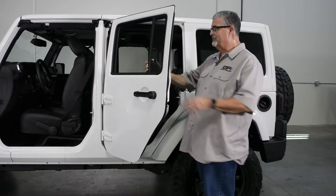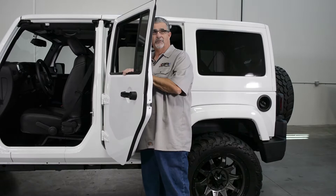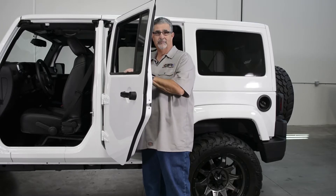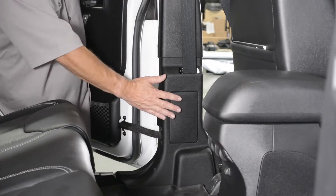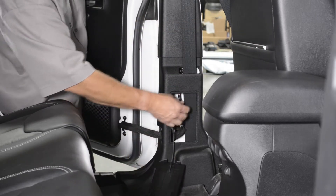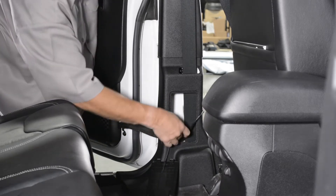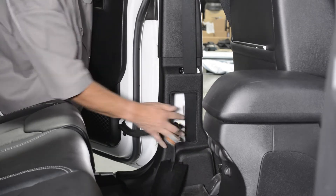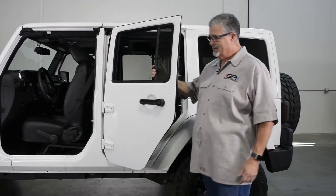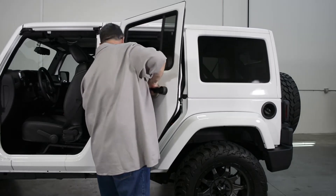Now that we've got the front doors off, let's jump onto the rear. You can see we have the windows rolled down. We're going to go inside to the B-pillar and there's a panel you undo — that's where you access your wiring harness and your release so you can pull the door off. Here's that access panel on the B-pillar. Move the front seat forward so you can get access to it. Pull down and pop it out — gives you access to the wiring harness. Here's the squeeze button, pull on it. Undo your loop and pull it through. Just like on the front door, we'll tuck it into the mesh that's on the door. Come around, reach underneath, and lift off.